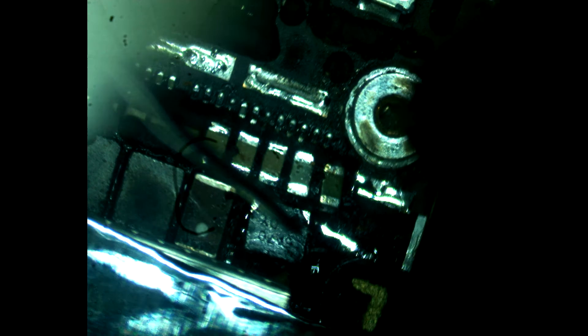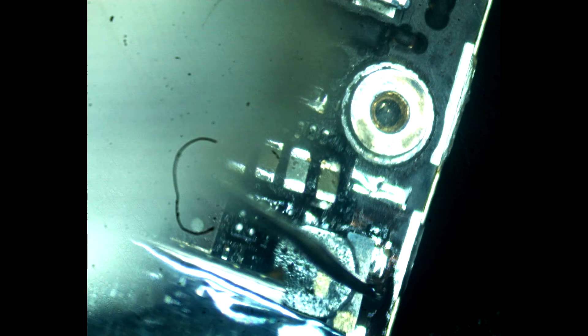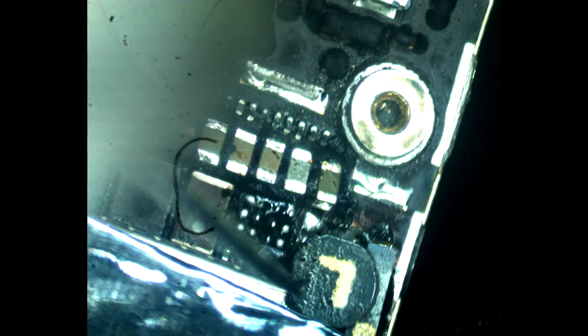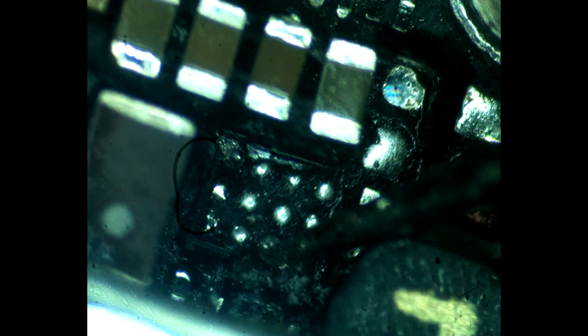At the end it stopped working, so once again I had to figure out what happened to my phone. I had replaced the L1503 chip but it didn't work out as it should, so I thought it could be the U1502 chip. This chip is a rather small part — it has 12 balls, with four balls that are not connected.